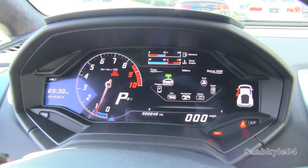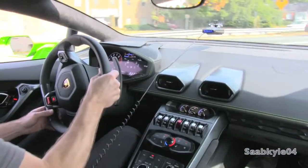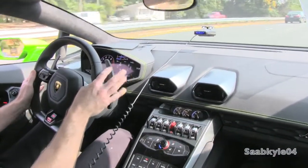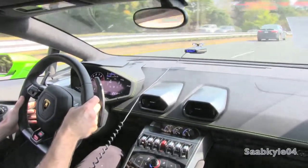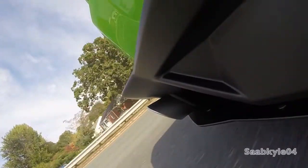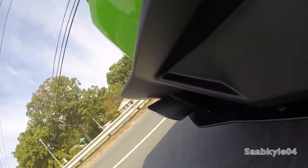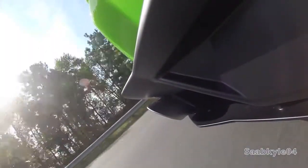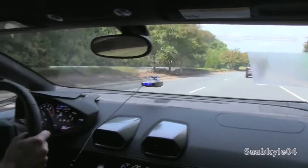Strada is Italian for a street or a road, and is relatable to a comfort mode. Sport dials things up a bit and opens up the dual mode exhaust, while Corsa, or Race in Italian, tunes the car for hardcore performance and handling. ANIMA stands for Adaptive Network Intelligent Management and regulates a whole host of systems from transmission programming to engine and throttle response, speed of the variable ratio steering, stiffness of the magnetorheological dampers, and all-wheel drive settings.